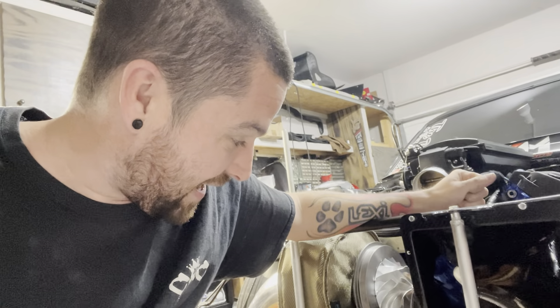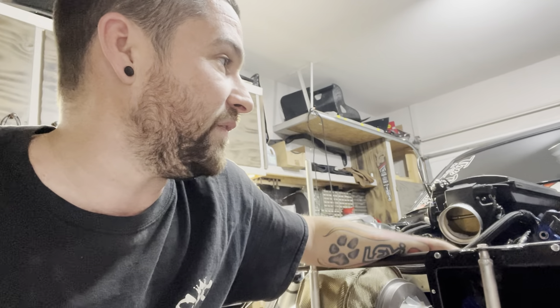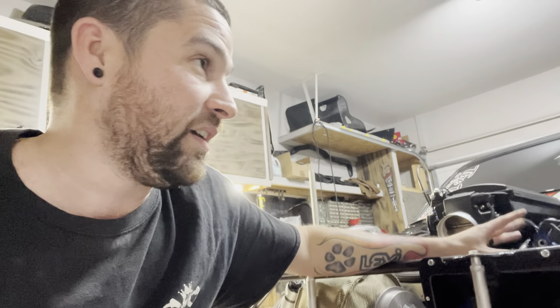So I didn't do that. Man, I can't even make this stuff up. I got the other ones just fine, but the one that mattered — we probably should have skipped this one up here or something. But the one that mattered, the most important V-band probably out of the whole turbo kit, I didn't tighten. So all the revving up and stuff, we had no issues. Somewhere along the lines the nut fell off. I don't know if it's in the trailer, in the rocks, in my driveway, or if the lawnmower is going to find it in the grass. But the nut exited the building. And when that happens, the V-band just popped open.